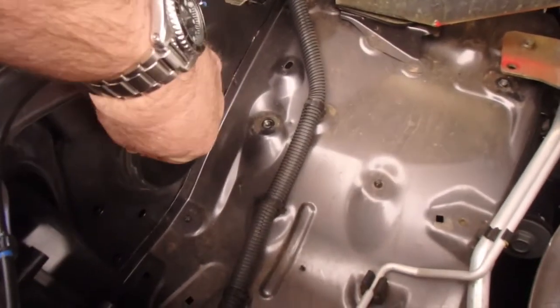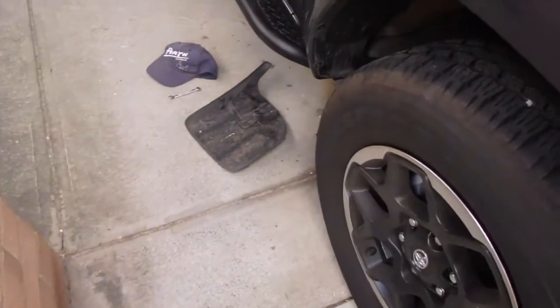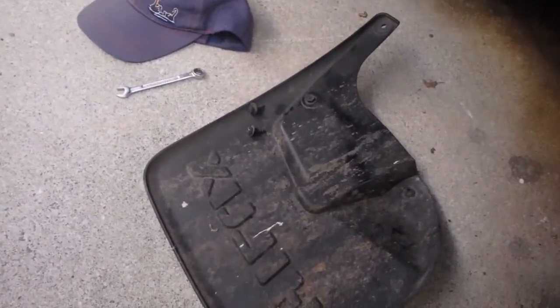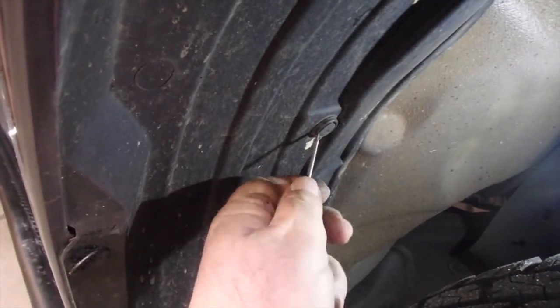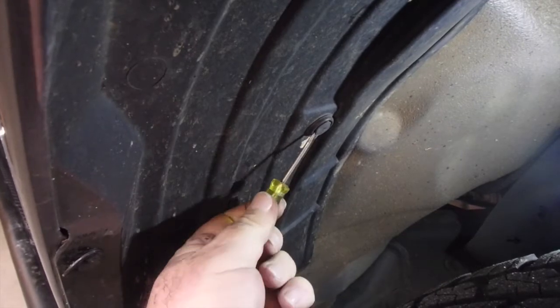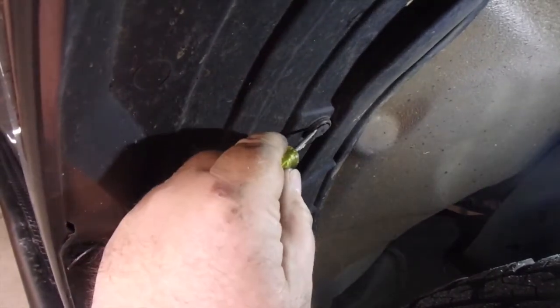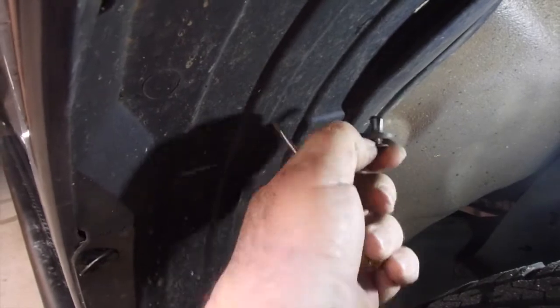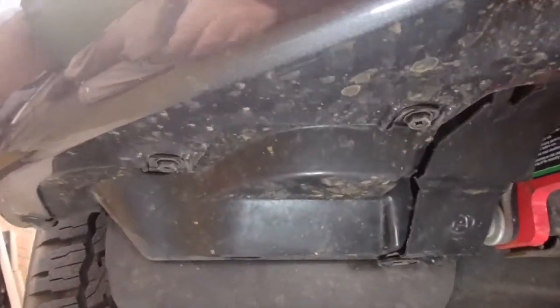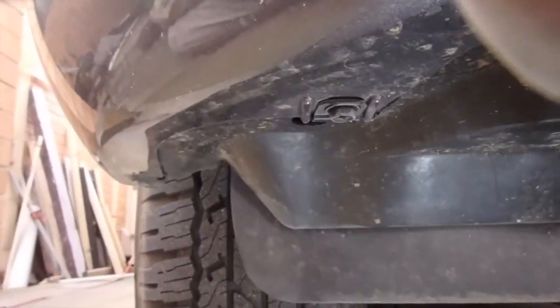Okay, the air box is out. There's the inner plastic insert that the foam seal was sitting around. The mud flap is held on by three 10mm headed screws. Now for removing these clips, you need to go gentle and unlock the inner piece — it's a male-female sort of joint. The inner guard is attached to the front bumper bar by three screws and also a clip. I've got the inner fender down.